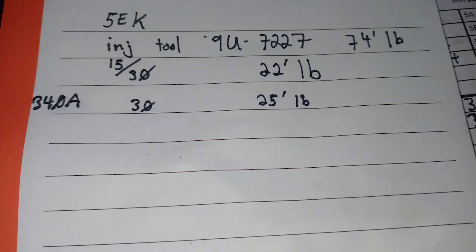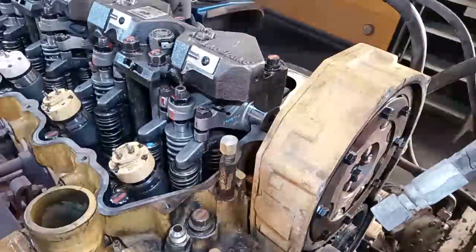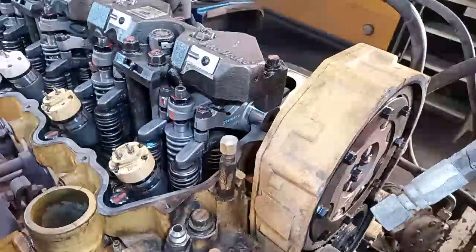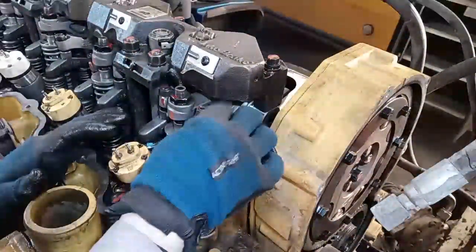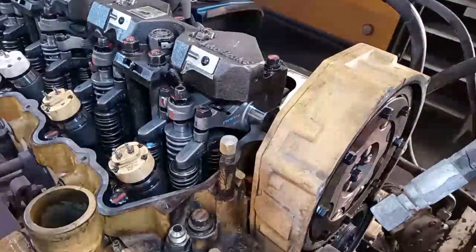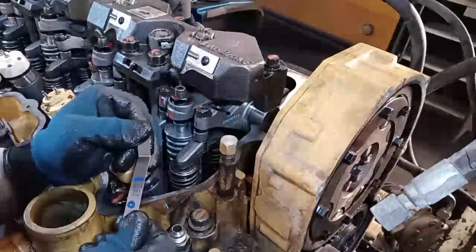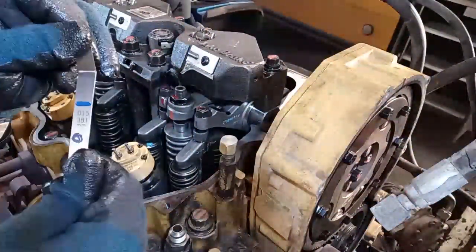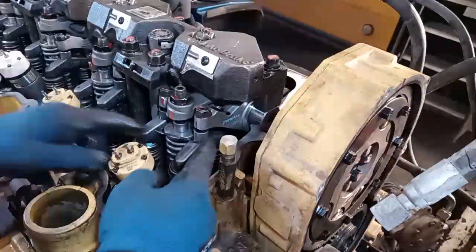You can use actual CAT tools for the injector height, pinning tool, and turning tool, but they're about 10 times more expensive than the ones on Amazon. We're going to start on number one on the intake. The term 'light drag' is used a lot when running an overhead — that's what you're looking for. I'm using the 15-thousandths feeler gauge here, which I've marked with a blue paint pen to differentiate it from the 30-thousandths.